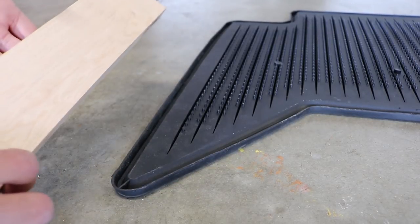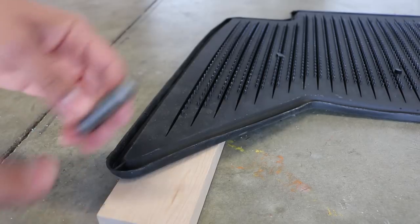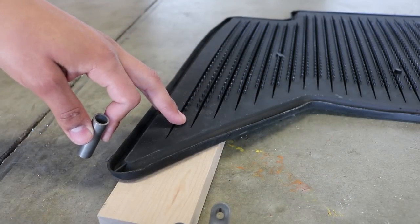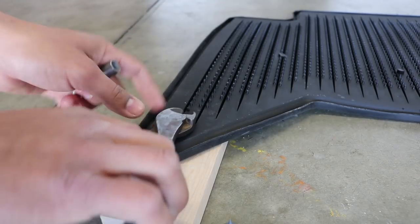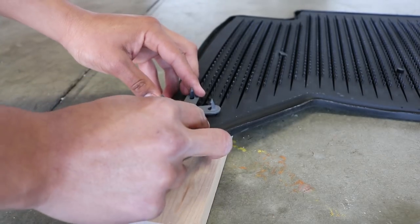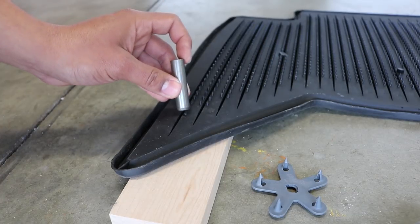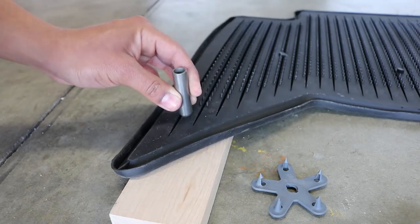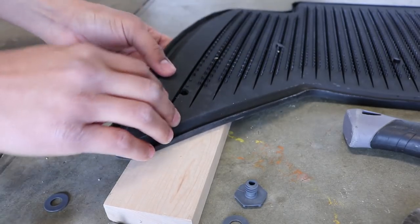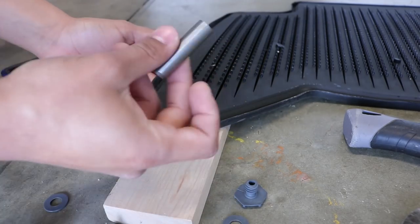Now that I've measured my floor mat and I know where I'm going to cut the holes, let me show you. This is where you might need your extra piece of wood if you have some. Go ahead and have your floor mat upside down and put it underneath. You want to get your handy tool because this is what's going to create the hole into the floor mat, so you can put the eagle claw in. If there are any rubber spikes, you can just get one of these little cutters and chop them away. Once I know I need to cut off three, give it one last measure, make sure it's good. Get your handy cutter — this tool does come provided with the eagle claw, but only if you pay the extra. Place it where you're going to locate it, get your hammer, and just start cutting away. Just like that — it's cut away. Keep in mind, if your floor mats already come equipped with holes, you can skip this step. If not, it's really easy to do. Make sure you pick up the tool to be able to make the hole.